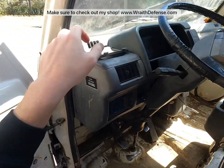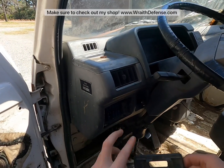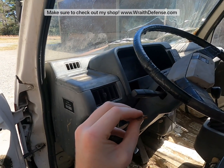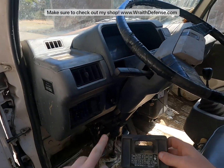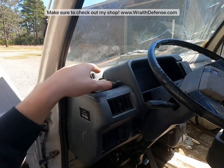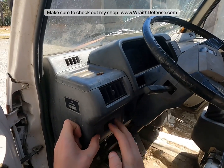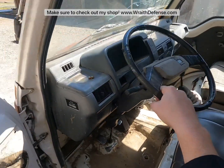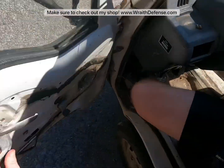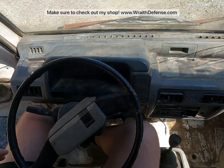Also, I went ahead and pulled off the fuse cover cap. We had a blown fuse in there, which for some reason someone chose a 5 amp fuse rather than the 15s it requires. So my tail lamp was out. I wasn't even looking like a motorcycle, I was just straight up, you know, no lights at all. But that's not a big deal for right now. I can replace that in a bit. Let's get back in this thing and see if we have gained any more RPMs.